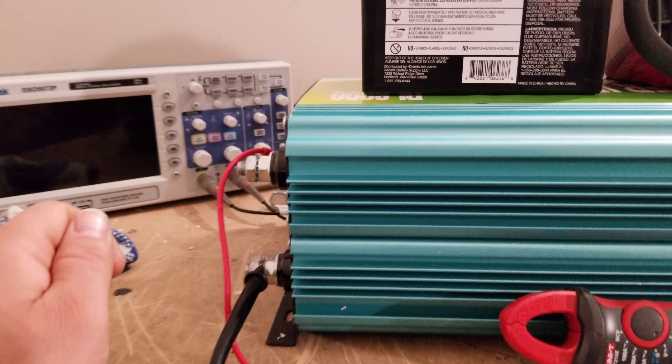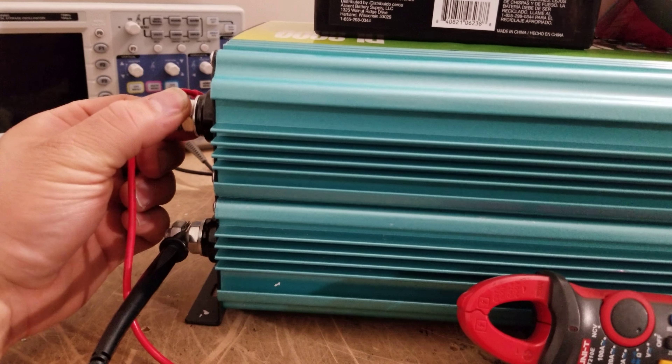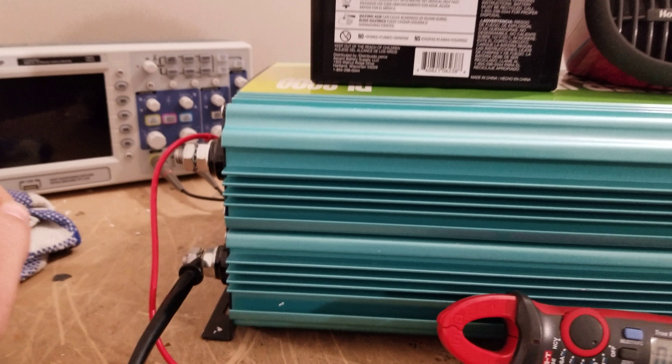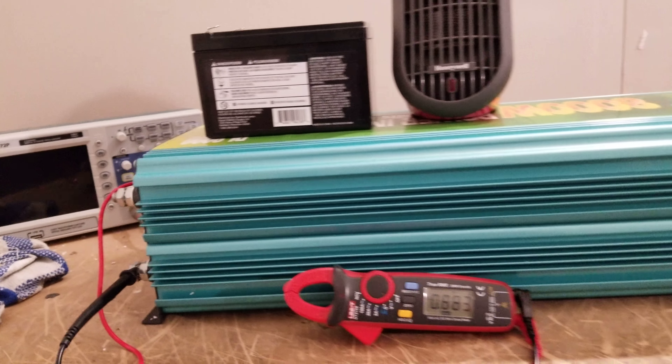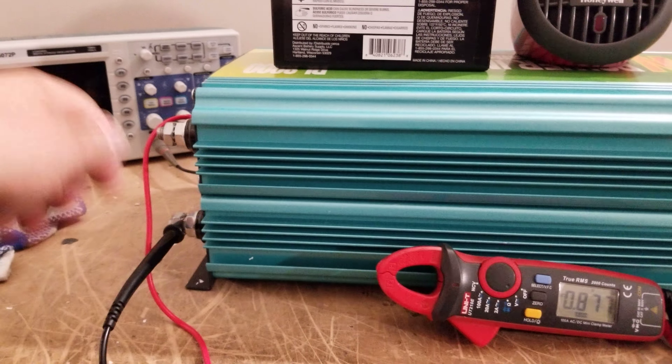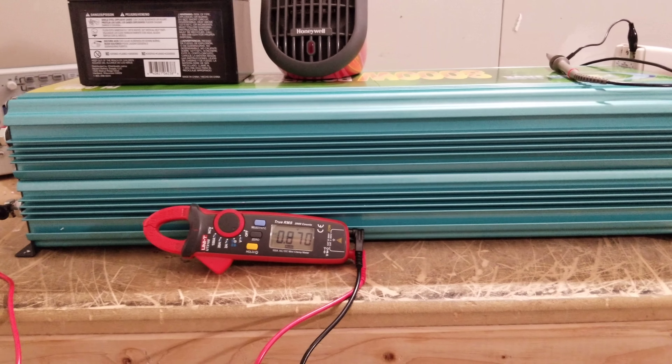If you're not too concerned about it, just be aware of it. What I used to do before any of that is take the battery cable and just smack the terminal real fast. If you try to come in real slow and be gentle about it, it's going to boom on you and scare you. So I usually just go smack, and then they're charged — it takes just half a second to charge those caps, there's a lot of current rushing in.